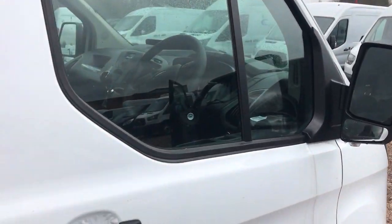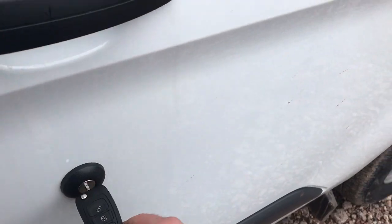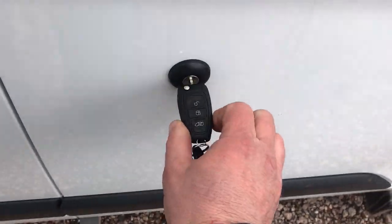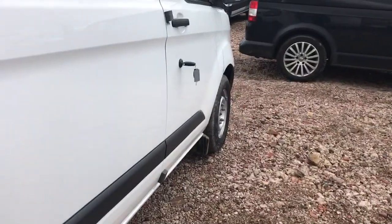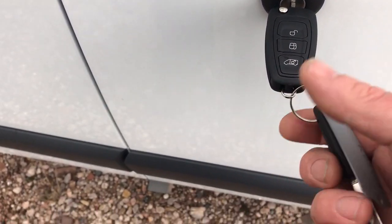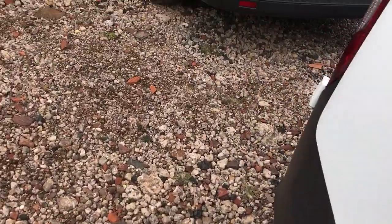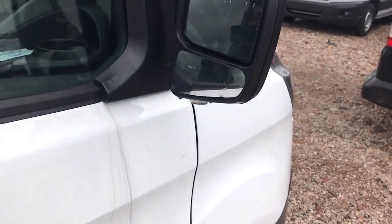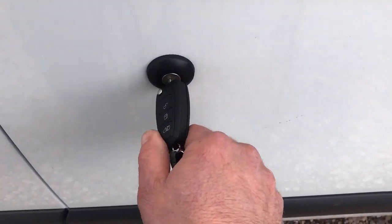It's been locked for about a minute now. Simulating an attack — that's unlocking the door but it's not unlocking the rear. Brilliant, that's fine, security patch working. Back door is locked, no jiggery-pokery here. Both keys are pre-registered. The left is unlocked — great, security patch has worked. If the patch hadn't been applied, doing that would open all the doors, you'd see the indicators flash, meaning central locking activated, and it would unlock the back.